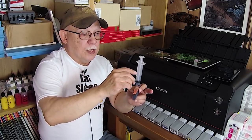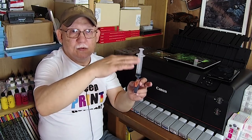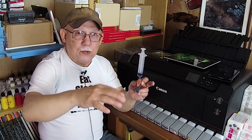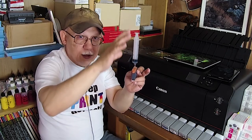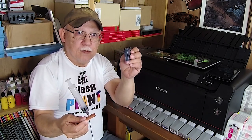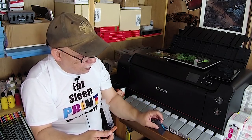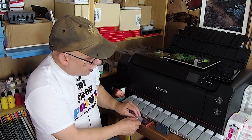You collapse the bag, then end up with a syringe extended all the way out with 15–17 ml — it varies. You can put in 16 ml for sure. Push it in — don't inject air, just ink. Then either pull it out or unclip it off the cart itself, put the original clip back on, and you're good to go. It took longer to explain than to actually perform, but this is the way you mass-fill Pro 10 cartridges.